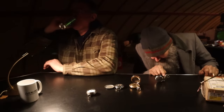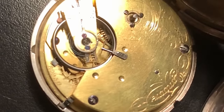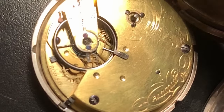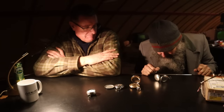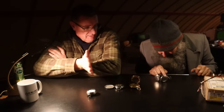And there's the winder. Yeah, and it's key wind, key set. You can see I'm a real expert, eh? Is that where you wind it? Yes, because the mainspring powers everything, and this one serves as a pendulum. That's right. It has to be neutral when you install it. So when you're trying to control the speed, you're really just shortening that spring so that it oscillates faster.